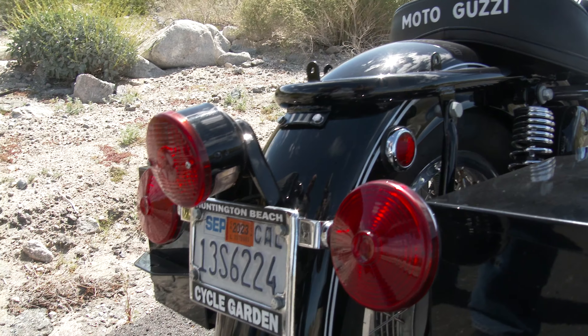Let me show you the four-leading-shoe brake. I'm going to do the front brake hub. This is a '73 and a half — they only made this model for about six months and then they went to the disc. That's basically the same brake setup as a V7 Sport. It's got the big Dietz Mickey Mouse ears on the front with the amber lenses — looks really beautiful. And there she is, the four-leading-shoe. It's got Dietz turn signals front and rear, or at least Dietz copies — I think those are probably PMs in the front and Dietz in the back.